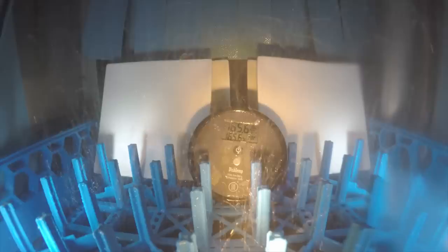With the DishTemp, you can actually adjust down the temperature of your washers to save on heating costs, as long as your plate surfaces reach a minimum of 160 degrees Fahrenheit.